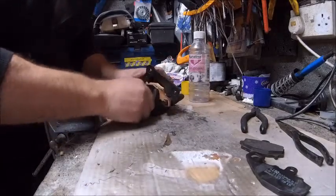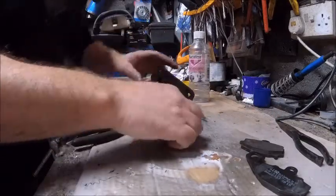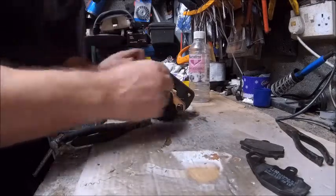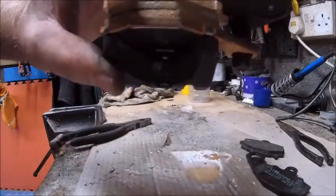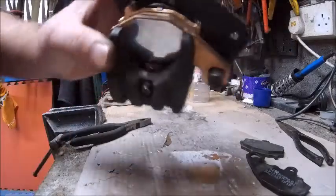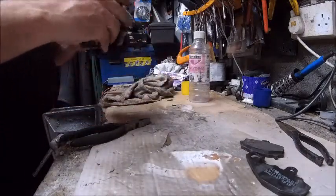I've run a quick drill through there - it's more a deburr than anything else. I think what's happened is just in the casting process it's got a little bit of swarf around the edge of it, so that now should fit on there - yep, there we go. That fits on there like that, that one goes in there like that, and then you run the pin through the middle again. Obviously that's going to fit inside that bracket. Pins through, just tap that home, the split pin goes back in there again. You can see it just retains it in there, and the pads are both in.